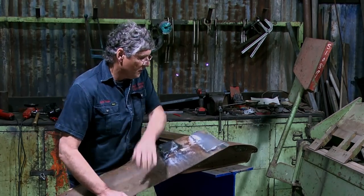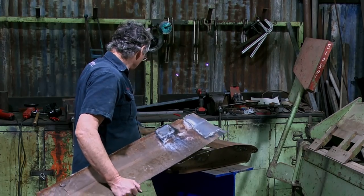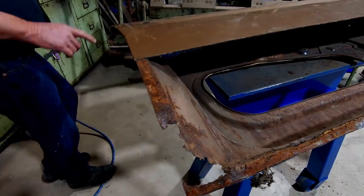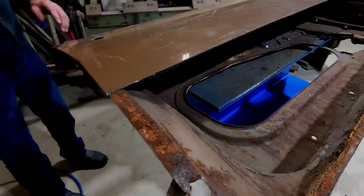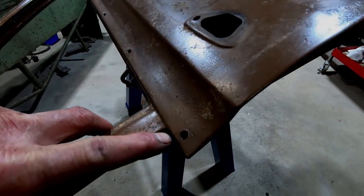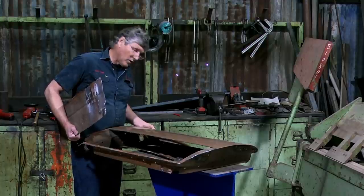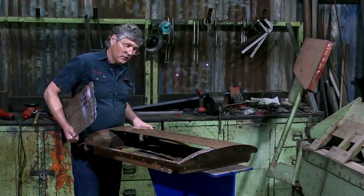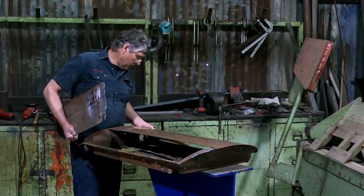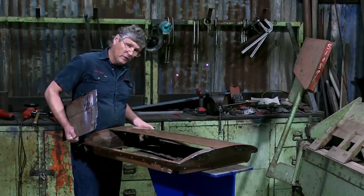The front's fine — we've got this edge here where we've got nice clean metal, but up this back edge here there's been some moisture creep in the panel. With a lot of these cars in this era, the ones that had mouldings on the doors, they drilled through the frame and through the corner of the skin for the moulding clip and anchor screw to go in there, and quite often that'll leak a bit of moisture in. Good thing to remember when putting your car back together and restoring it: if you can, weld these holes and then drill through the weld — they'll be perfectly sealed.